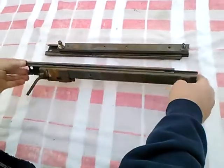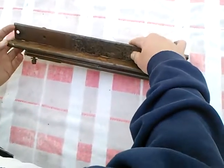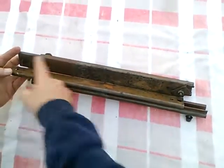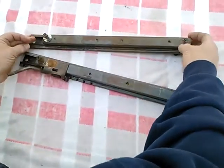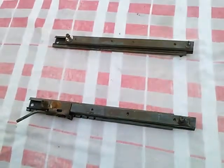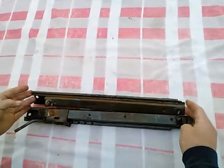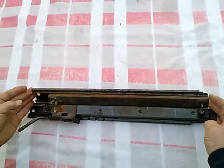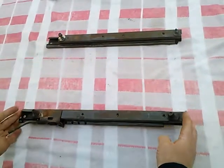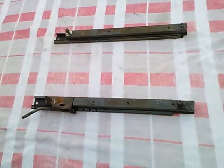So an overview — if you've seen my other video — on one side of the car like the driver's side, the bolt pattern that goes into the floor is the same distance apart on the seat track, but on the car floor it's not a rectangle, it's a parallelogram, which adds complexity. Also, the studs that go through the seat are not evenly spaced, so you've got these tracks in the car offset to one another and these distances not the same. This is why the driver's seat won't fit on the passenger side and vice versa.